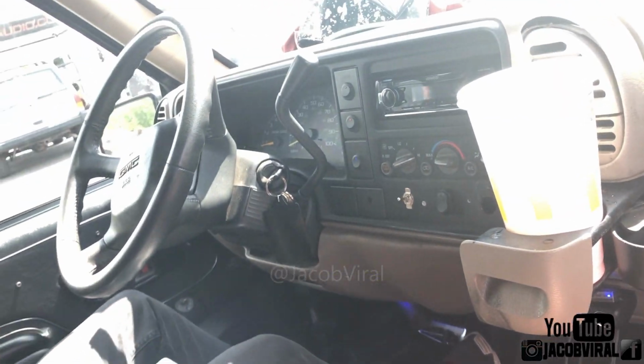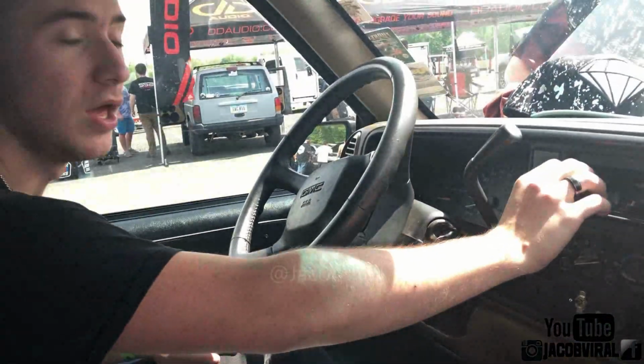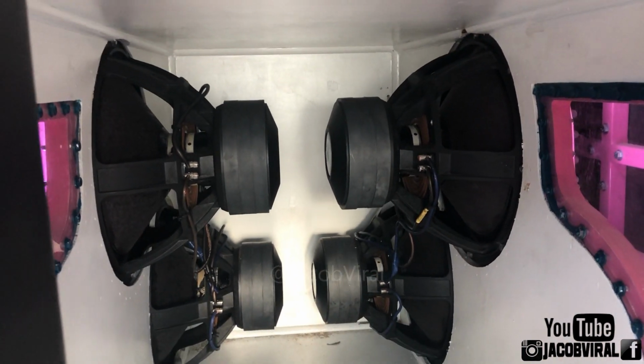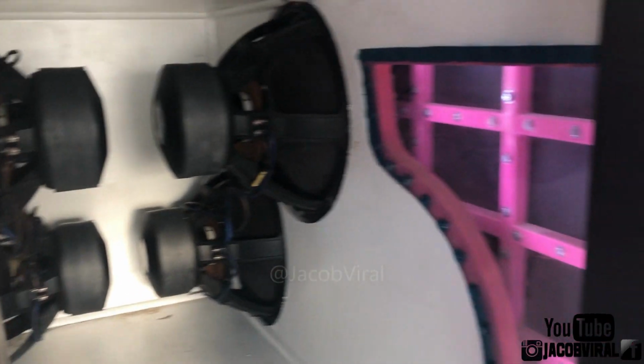So they put those two 8Ks on there. Everything's at 2 ohm now. Okay, so all that was at 2, a lot more clean and efficient. Well, yeah, because the 15K was at 1 ohm. The amp itself was at 1 ohm, and the subs are wired to 2 ohm. So now that we got the wires back to 2 ohm a different way, and we got the amp at 2 ohm, everything's gonna work out a lot better now. Heck yeah.